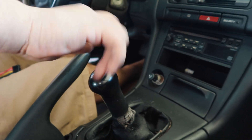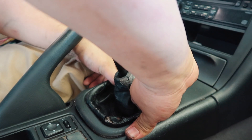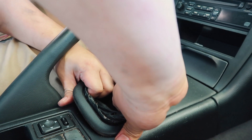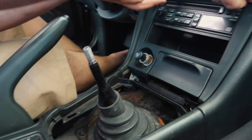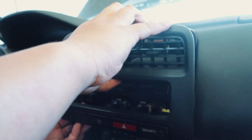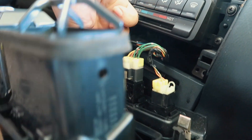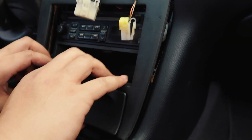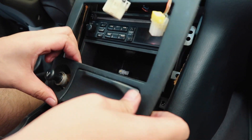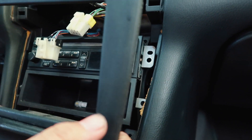We're going to disassemble the inside of the car. If you have an S14, you pretty much just need to remove the shift knob and take off the shift bezel. Be careful not to break anything — the older this car gets, the harder it is to find these pieces in good condition. Pull off the harnesses in the back. Interestingly, there are no screws holding anything on back here.